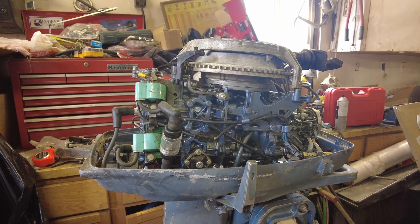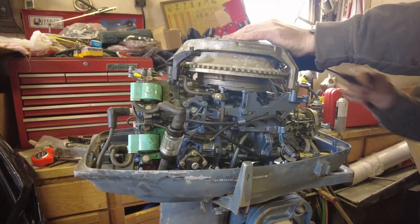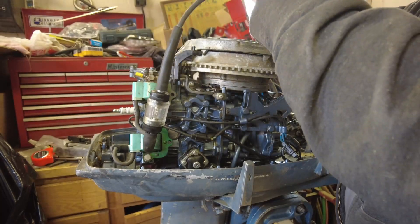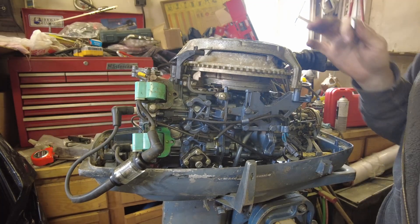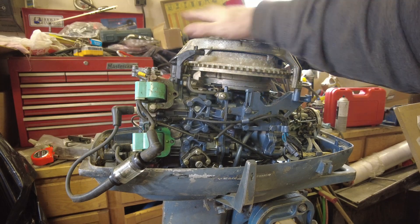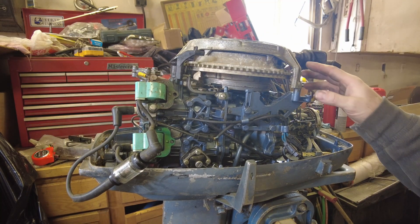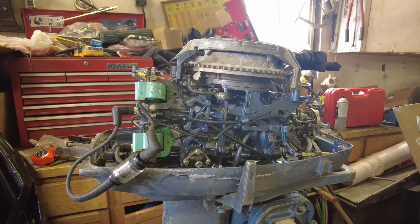Well, I gotta admit, this one's got me stumped a little bit. Right now I'm out of the coil, through the spark plug tester, and into the spark plug. I'll pull this thing over and I don't think we're going to see any spark. I don't see anything. But yet, when I take a bolt in the end and just drape it up over the top, we've got good spark. Now, we haven't done anything with the points on this, so I'm wondering if the points are somehow gummed up and the recoil cover is getting a good ground but the rest of this stuff isn't. So I'm going to pop this recoil off, and then we'll see if we can get the flywheel to pop off without too much difficulty, and we'll see what's going on underneath. I have a sneaking suspicion there's a set of points under there that are a little on the fuzzy side. Let me get some tools together and we'll take this thing apart.